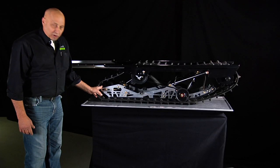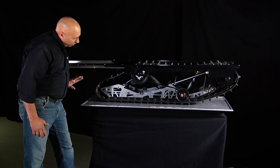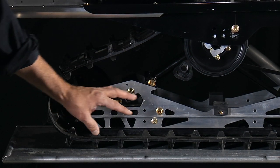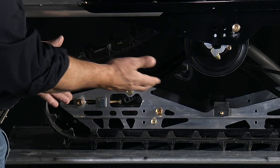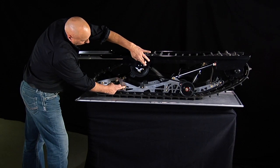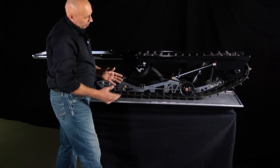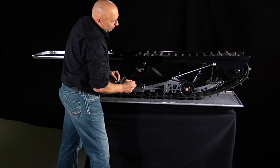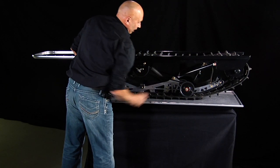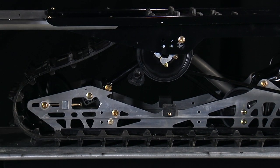The rear wheel of the skid frame is what's driving the snowmobile — the track pulls over the top, therefore pushing on the rear wheels. The rear wheels are attached to the skid frame, which is a solid member. There are two arms on our skid frame: the rear arm is attached here and here, the front arm is attached here and here. The front arm is a solid member connected to the rail up to the chassis, simulating a side tunnel of the chassis.